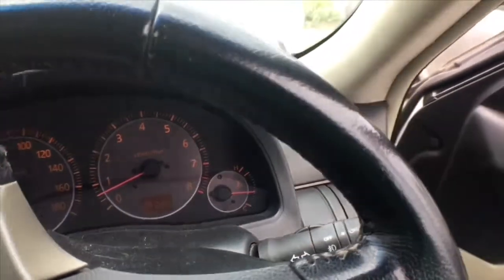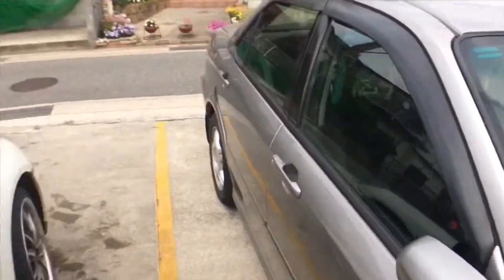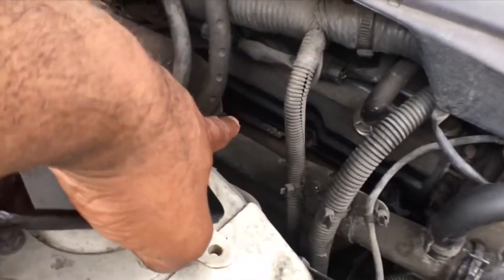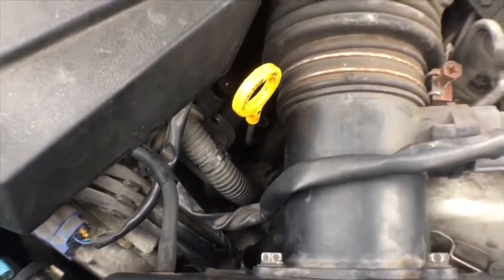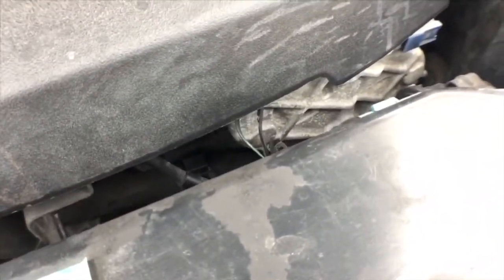The car's temperature is also where it should be. We removed the thermostat, so in wintertime you'll find the car takes a little more time to warm up — but that's the only downside. We have no water leaks. The engine is running nice and smooth. There are some oil leaks — I think it's the head gasket or the camshaft cover gasket leaking on both sides — but there's no water leak where the thermostat housing is. That's it, job is done. Thanks for watching — much more to come.